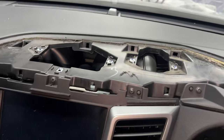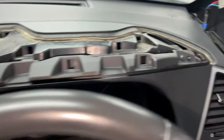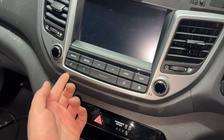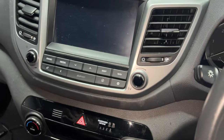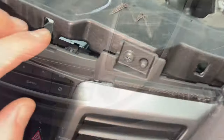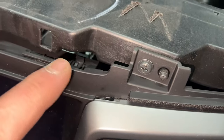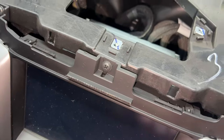With that top trim now removed, you can now see these Phillips screws — there's a couple more this side just here. The next thing is to remove the radio screen with all the buttons. You need to get a pry tool in this gap; the silver trim with the buttons will then come off. You've also got three screws to undo for the screen. You've got two clips — just need to get a little pick behind it and lift it up. Don't just yank it off because you will break these tabs.